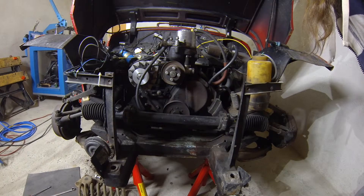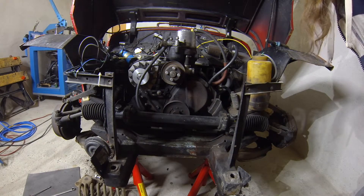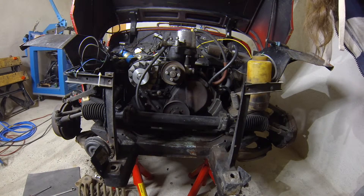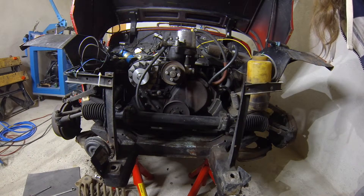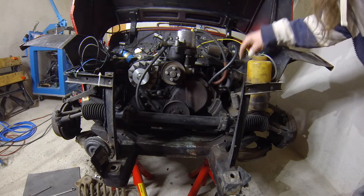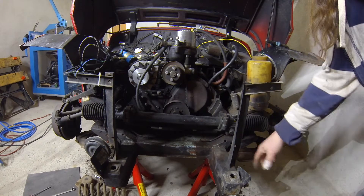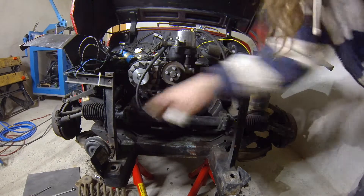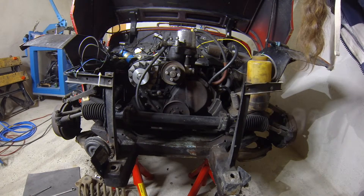Well, that'll have to be it today. I got the other spring out and cleared a load of sticky nasty goop off the underside. I had this wonderful idea that if I unbolted the dampers, the wishbone thingies at the bottom, and the bolts that held on the suspension, I could pull all of the front stuff away in one.